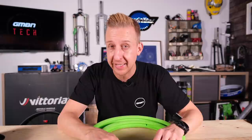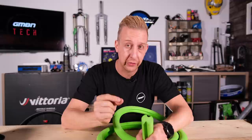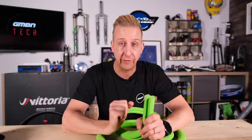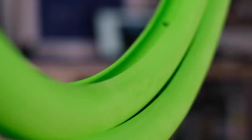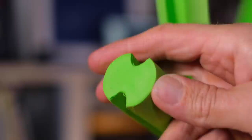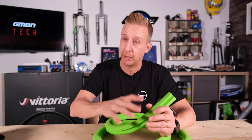Next up is the airliner system. A lot of cross-country racers are choosing to use tire inserts for a couple of reasons. Firstly, it minimizes the chances of slashing the tire casing from pinch punctures — that's where the rim essentially slices the tire against a rock under an impact. It actually helps stop that because the tire can't deform all the way down. It also protects your rim, which means if you're running a very rocky cross-country course and you bottom out, it can help prevent cracking and damage. Most importantly with a design like this, they're designed to let you run your tire flat. If you slash the tire or get a flat in your race, you're not going to damage your rim if you continue riding. It's possible to ride for an hour on these without damaging your tires or rims further. They'll actually last 2,000 hours of regular use and they weigh just 90 grams — just 90 grams for all that protection. It's a win-win.